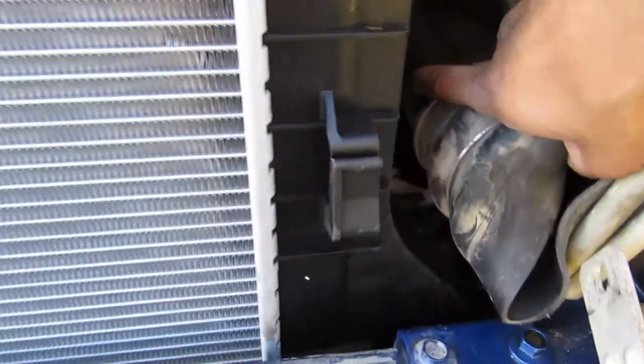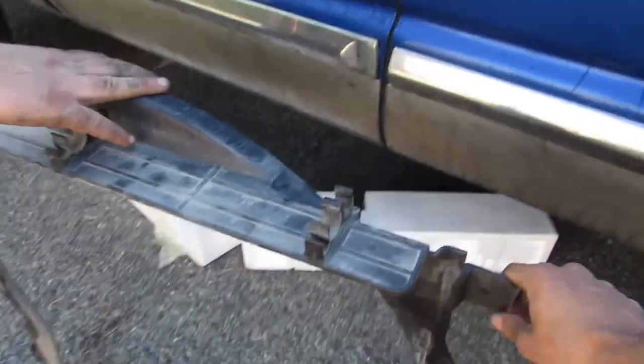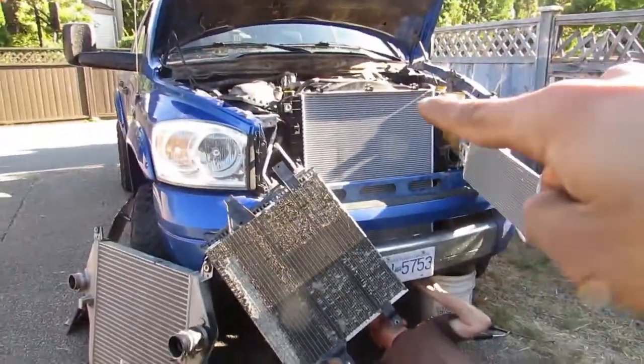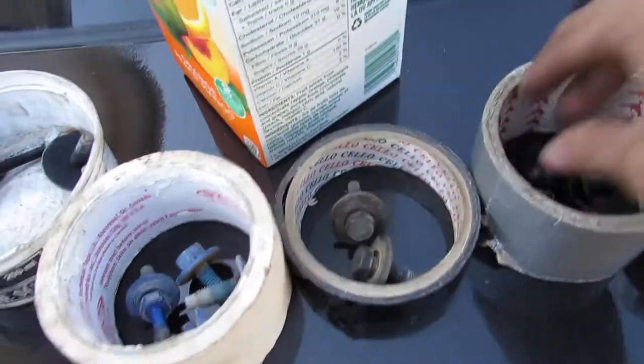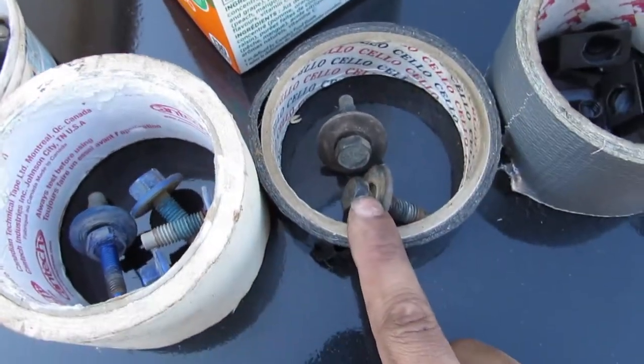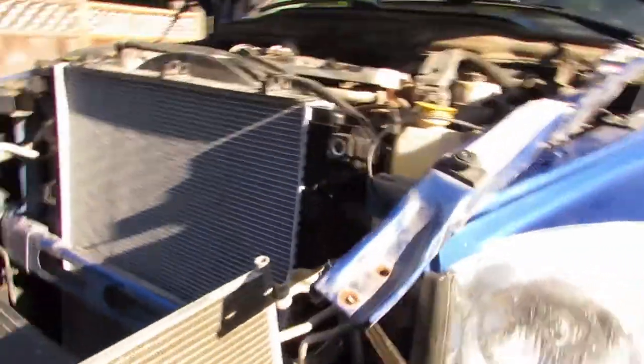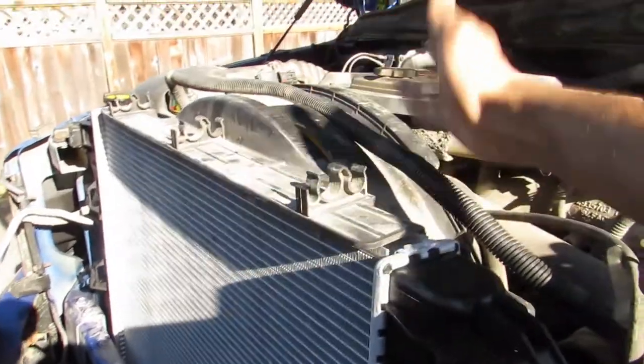Okay, so we got the rad just sitting in place. This boot was a bit of a pain because this clamp right here is like perma-clamped, so we just have to kind of push it and finesse it. In place, we're going to get the shroud — that plastic guy — seat that in place. That one just bolts and slides into place, and then this was that top bolt that went to the rad mount. So the rad pan's in, the shroud is in. Remember to put those inserts back — they're 13s. These are the little flag inserts with a captured nut. Mike's doing the rad hose. After we do the rad hose, order of progression: we're going to do the shroud bolts, then the upper radiator metal support bracket, and then tidy up the hoses back into their clips.